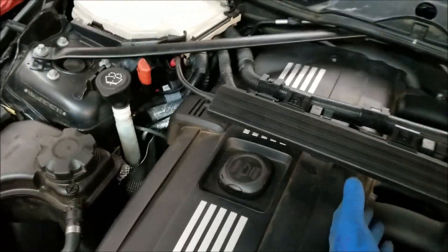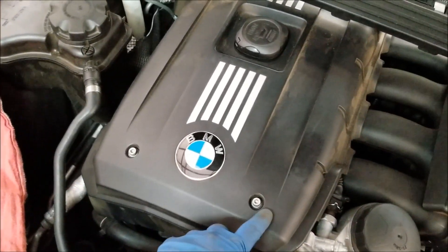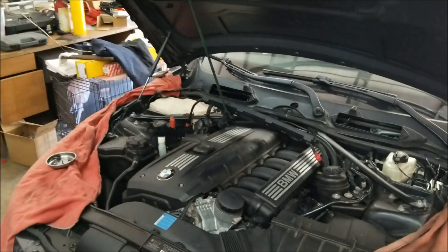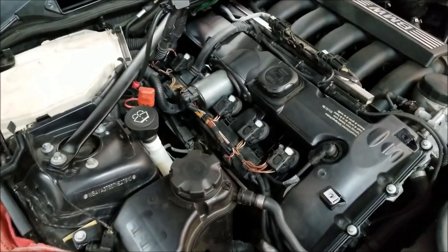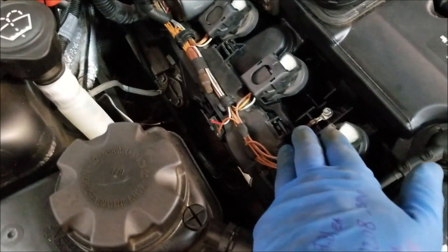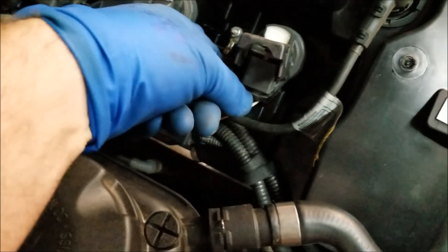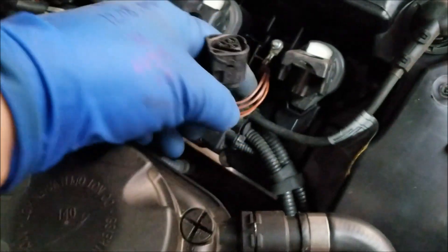Except for these wire harnesses, we now have great access to the top of the engine. We can now remove the screws holding the engine cover on, which will expose our ignition system. A bungee cord can be used to carefully lift the wire harnesses away if you prefer to keep them out of your work environment. Now that we've gained access to the ignition system, we can see each coil pack — each coil pack has its own connector. As you lift the tab on each connector, it will try to spit the connector at the bottom. Carefully pull it out and disconnect it.